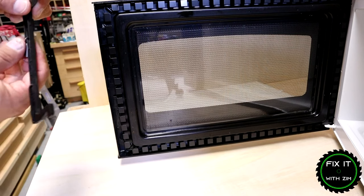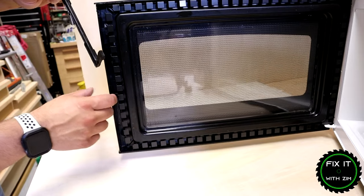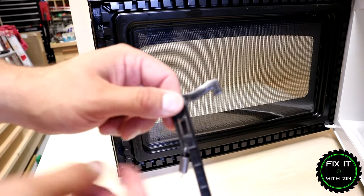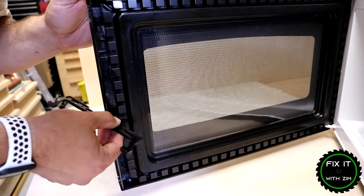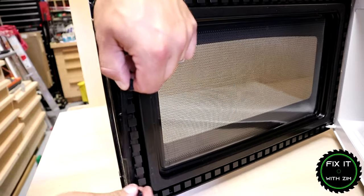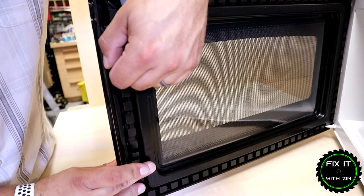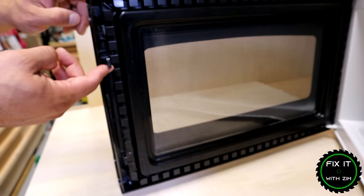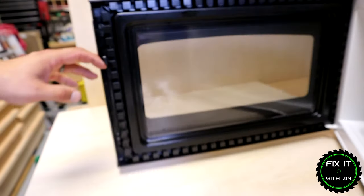The most — well, it's not really difficult, it's just a little tricky — part of this process is getting the spring clipped back onto that bottom piece and putting the latch into place. What I found is the easiest way of doing that is putting the spring onto this first, then getting in here and clipping it over that bottom piece like that. Then you can lift the whole assembly into place and drop it on. You can see this is exactly how this was intended to be from the factory — it's got tension when it slides down and it'll latch shut when we close the door.